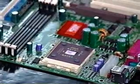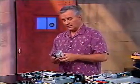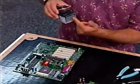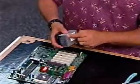Close the lever all the way around and that grips the processor so it can't fall out. Now that we've got the processor in, it's time to put our cooler on. Today's processors run so fast and so hot you cannot use them without a fan on them. This is a very common fan — it's got heat sinks, these fins here draw the heat up, and the fan then blows the heat away from the processor to keep it at a reasonable temperature.